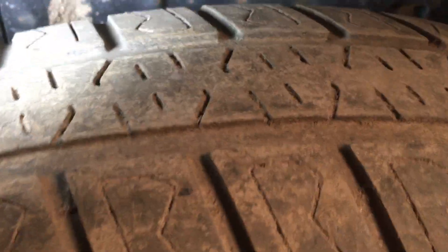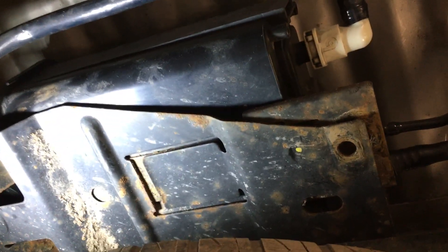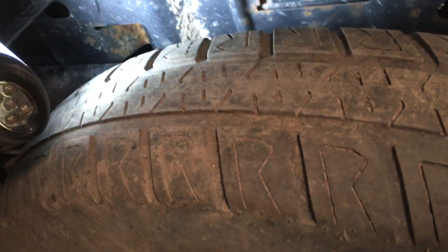There are two clips. I just wanted to make sure I could get that 13 millimeter bolt out before undoing these lines, because if it's not coming out easily, then taking the lines off is a little futile. As you can see, the spare tire is still in there — it doesn't seem necessary to remove it. I'm just laying on a cardboard sheet underneath the vehicle; it's not even jacked up.